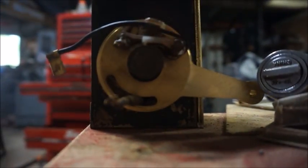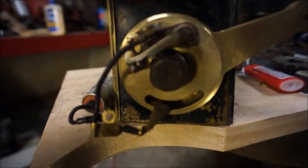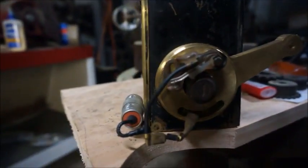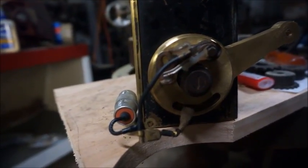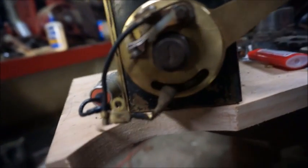Okay folks, here's what we've got — Volkswagen points. Still gotta drill the hole and put the set in there, but I've done the hole so tight that I could slide them in there without any problems, just for testing. I've cleaned up the points and put a temporary capacitor on — this is out of a Fairbanks Morse magneto — until I can get one I want to run. I'm going to run it either in this cover or inside the cover because it's got to be able to hook into that wire.